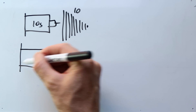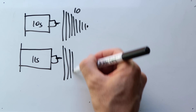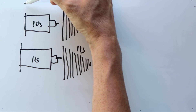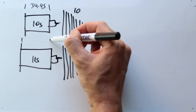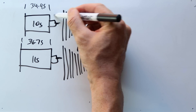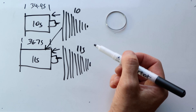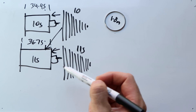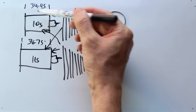Almost the same deal, with the axle through here. Into the measurements: the distance on the 10-speed freehub is 34.95mm, and the distance on the 11-speed freehub is 36.75mm. So compatibility-wise, it's a given — 10-speed goes on 10-speed, 11-speed goes on 11-speed. And you can put a 10-speed cassette on an 11-speed freehub using a 1.8mm shim, because that's the difference between the two. But I wanted this 11-speed cassette on the 10-speed freehub — and herein lies my problem. There's not enough space on here to fit this cassette.